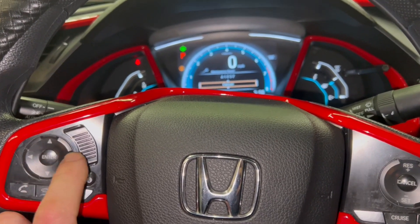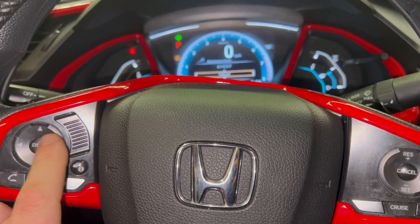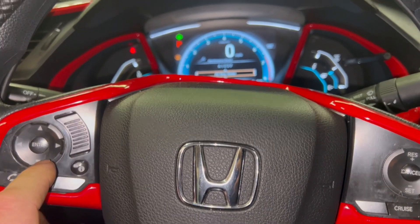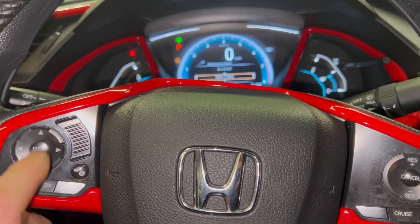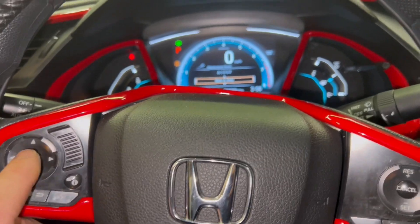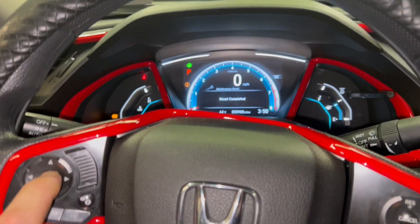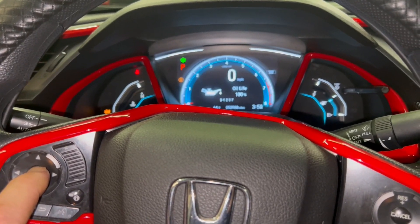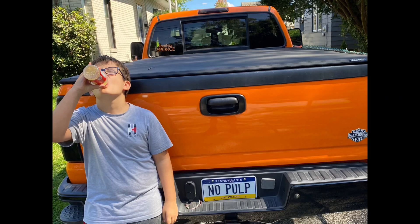Now you can do all these different things. You scroll to 'All Due' — if it's time for a coolant flush you'd do that — but item A only is what we want, because item A is the oil change. Then hold the button again for 10 seconds until it resets. Boom, easy.